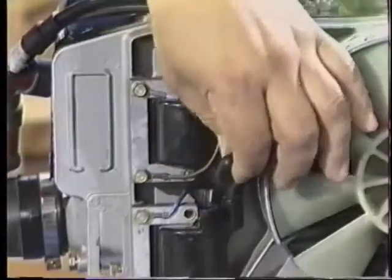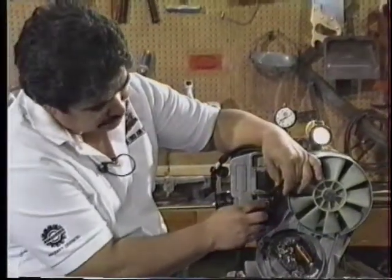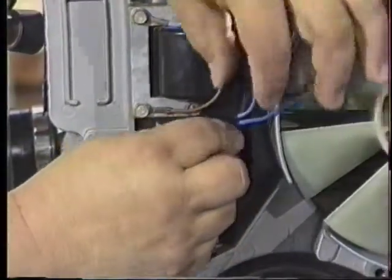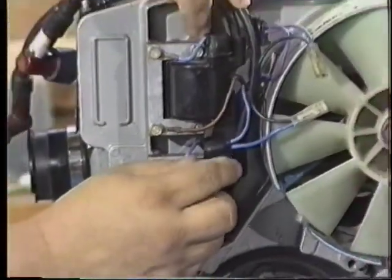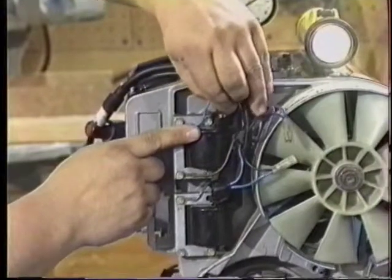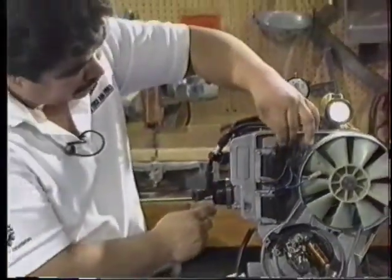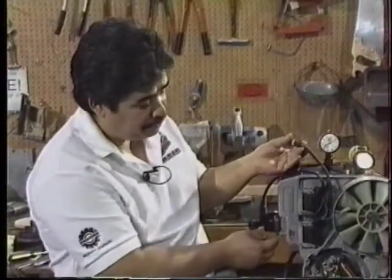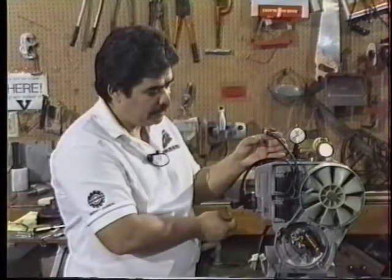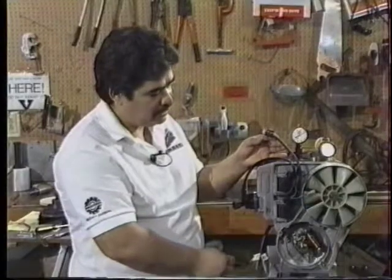Up at the coils, the wires come up out of the ignition system and have to be applied to the coils again. We usually use a dielectric grease here — dielectric grease isolates from moisture and any materials that can cause corrosion in these connections. So we'll use dielectric grease and put the connectors back into place. The coils also have a ground wire with a connector that has to be maintained — by removing it you can tell if there's corrosion, and dielectric grease is also recommended there. On the plug wires themselves, with age, dielectric grease works as a good insulator against the elements if your engine is left outside or weathered. A little bit of dielectric grease on all the components will protect them from UV or chemical damage.